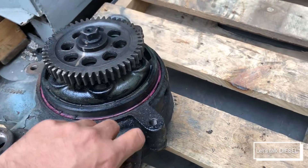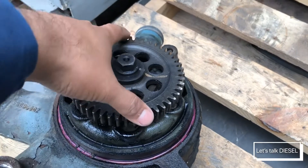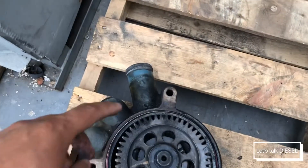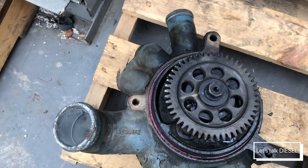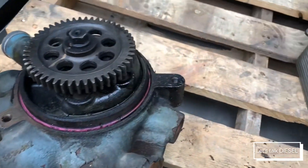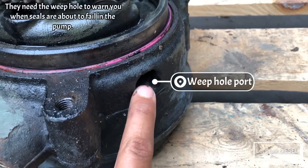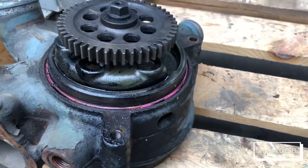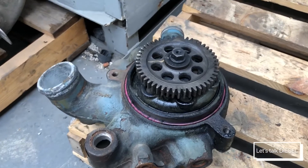As you can see, Detroit really makes so many things going to this water pump — no wonder it was expensive, and I believe it still is. The water pump gear was driven by the accessory gear. The problem with this design: if you didn't install it properly, number one it's gonna leak a lot of oil, number two your truck might overheat, and number three you may stop the gear system in the Series 60. You can see the breather hole — it usually leaks from there or from the cover. Those were the main spots where you'd say your water pump needs replacing.